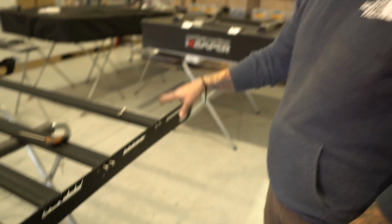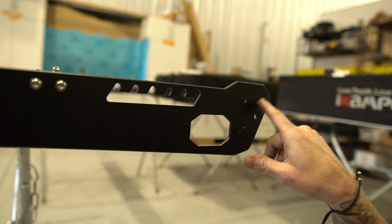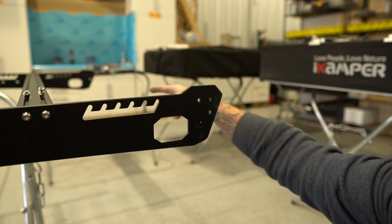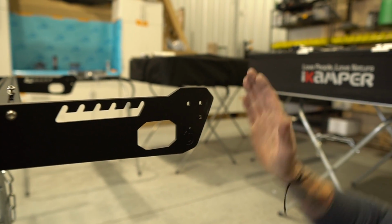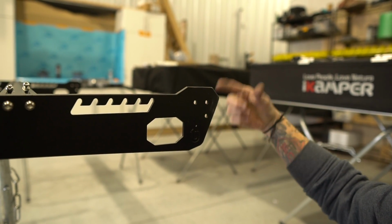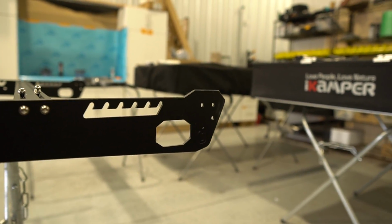So, the back load bar, the number 6 load bar in the rear. If you look here, see the 3 holes? If you're running our optional thin fin, you can run this back load bar in the same configuration as this. So it goes here, giving you 2 inches of mount surface in the back. If you're not going to run the thin fin, the factory shark fin antenna sits right underneath where this load bar would be. So you put this load bar in here with these 2 holes, it flips backwards. It's still dead level with the other load bars. It's just 1 inch wide here, 2 inches wide this way. It still gives you enough surface area to mount lights or a chase light or anything else that you want to mount to it. But it's a cost-effective way to get the 6th load bar all the way back so that you're full length on the roof rack of the truck, or on the roof of the truck, right?